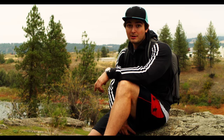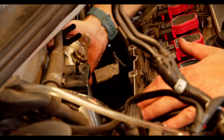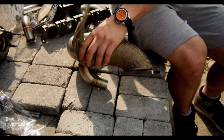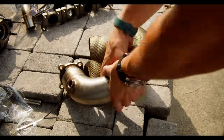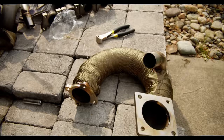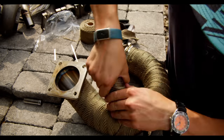Everything being up top near the firewall generates a lot of heat, so our heat management has to be top tier. I went with a name-brand titanium wrap because if it's going to work, I want it to work as well as it can. My goal is to wrap the entire O2 pipe — keep it tight, overlapping by about half or a quarter inch. Where the pipe has ports, I doubled up the back end so I could leave those ports untouched. There are no adhesives keeping it in place — it's entirely friction, and these metal zip ties around the ends.